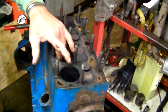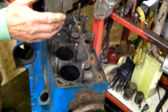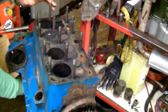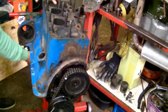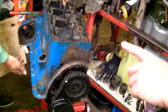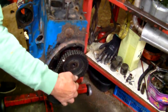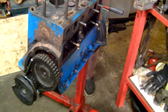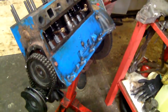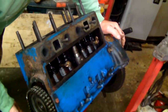You have to watch all the valves — there's no piston in there, I've got that out. The main thing I'm trying to get over is the fact that when you're on TDC, it'll either be four or one, and the only way you can really find out — unless you take the valve cover off — is you can then see the pistons actually work. And I'll just put it over for you — that's what I've got to get into to put your little dowel in.